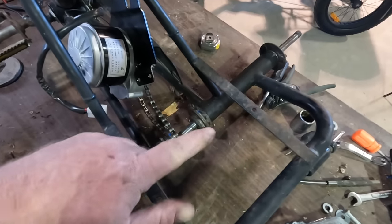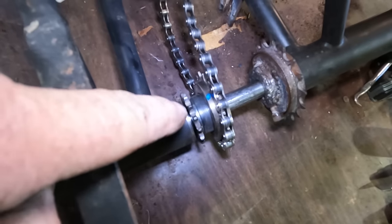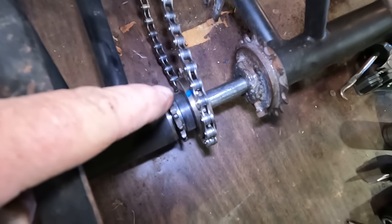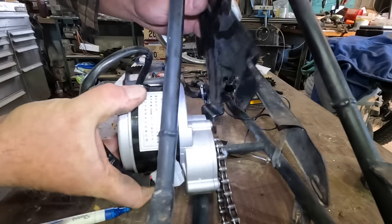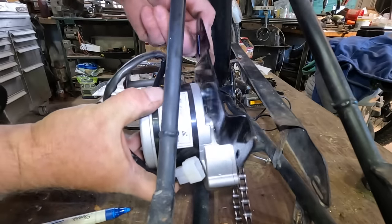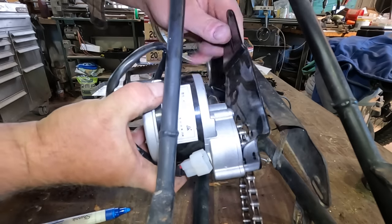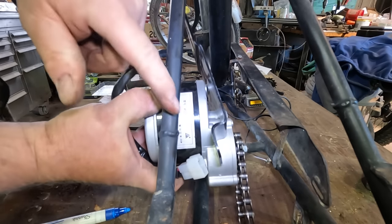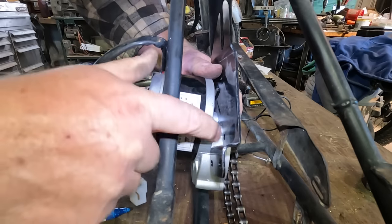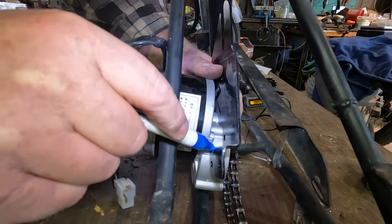Got the new bearings in, axle shaft is in, got the original sprocket back on for the pedals, and got my adapter with the new sprocket on — mocking it up. This motor came with a bracket that looks like it was meant to mount with the flanges pointing outwards, but I want to mount it a different way to catch these tubes on the bike. The motor casing hits the tubes, so we're just going to make a little clearance there.